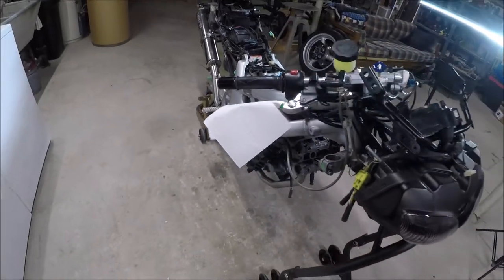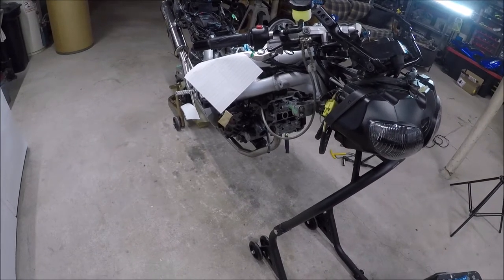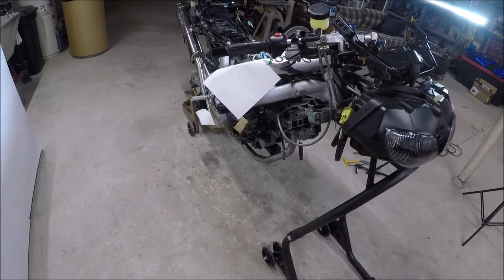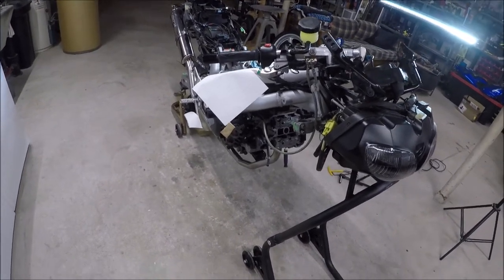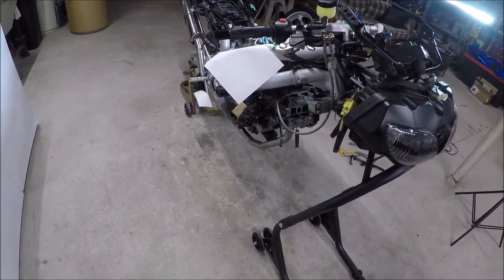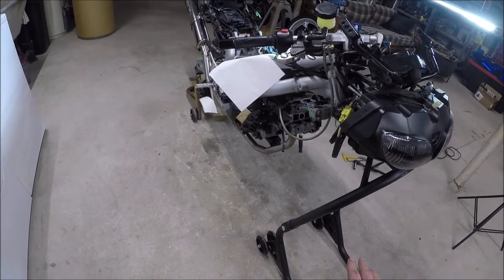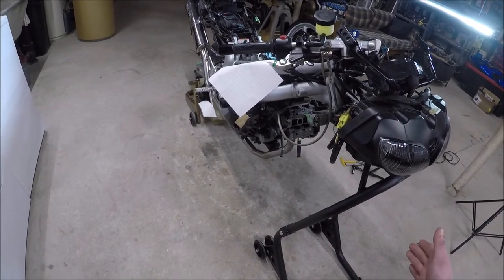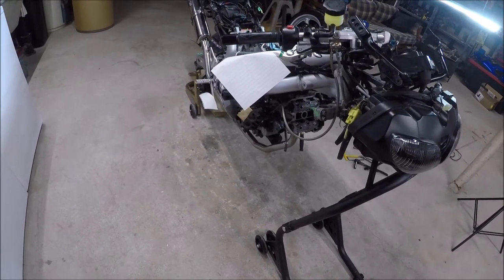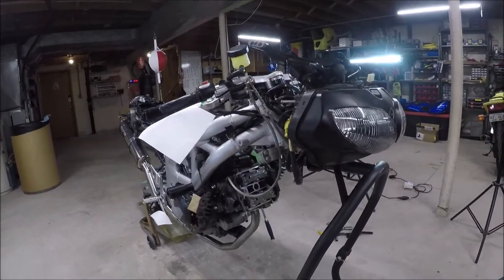Because I am adjusting every single one of them, I'm going to open up the clearances on every valve on this bike. Because I'm going to push it to the center of tolerance. This bike has got 27,000 miles on it. It's not going to change much more than this. The shim under bucket type of engine, it shouldn't change too much more. I know this has never had an adjustment done on it before. So pretty much where it's at now, it's probably going to be here for at least the next 20,000 miles. I'll check it again next year, but I'm just going to set it once. So I'm going to set to the center of tolerance. The 0.004 to 0.008, I'm going to go to 0.006 roughly. And then 0.008 to 0.012, I'll just go to 0.010, depending on the shims that I've got available.